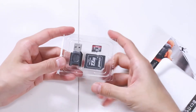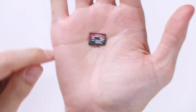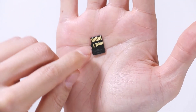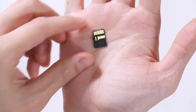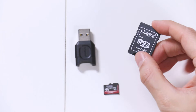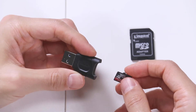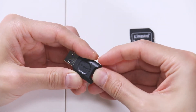Pull it right out and open from the bottom. Here is the microSD card — really, really tiny. Flip it over and you'll see the second row of UHS-II pins for faster read-write speeds. This is the microSD adapter; it doesn't have a second row of pins, so it's probably not capable of transferring as quickly. But this dedicated card reader is designed for fast transfer rates, so stick the card in there for the best speeds.